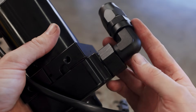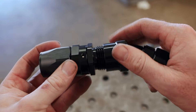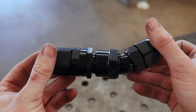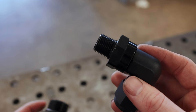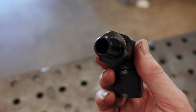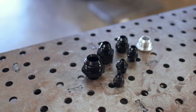The adapter is more than acceptable and it's the way I'll be using most of the AN fittings on the 308. Last but not least is a very uncommon type — a hose end with a male end on it. You won't see these very often, but it's useful for joining hoses if you need to splice something in or change from one hose type to another. You may also find that you want to adapt AN fittings to other devices — for example, NPT thread, which looks like an O-ring bung but has tapered threads. This would definitely need sealing tape but allows you to connect to other accessories. There are also banjo fittings, hardline adapters, crimp lines, push locks, and countless others, plus adapters to put pretty much any of them together.